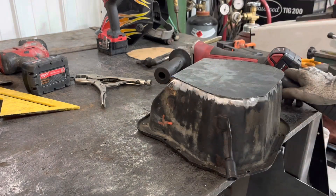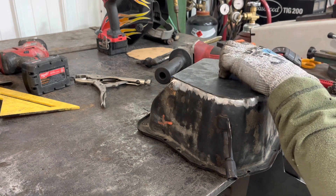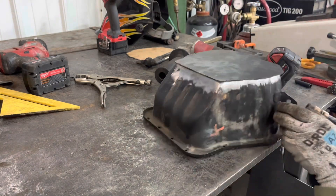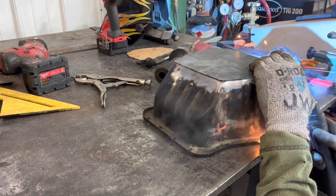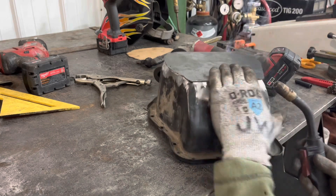I've cleaned this up pretty good and we're going to weld the pan on now that I know what I have for clearance. I'm going to bolt it down and set to go. It's got an overhang — I made it when I traced it out with a pen to give an overhang, so I've got a shelf under here to weld for maybe 3-sixteenths of an inch. Now I get underneath and just give it a tack — that corner, holding down on it like this as I'm tacking.